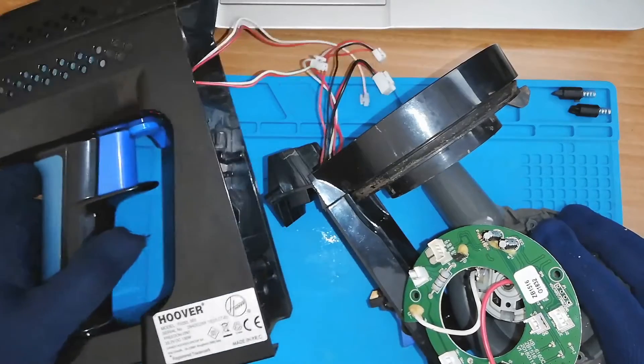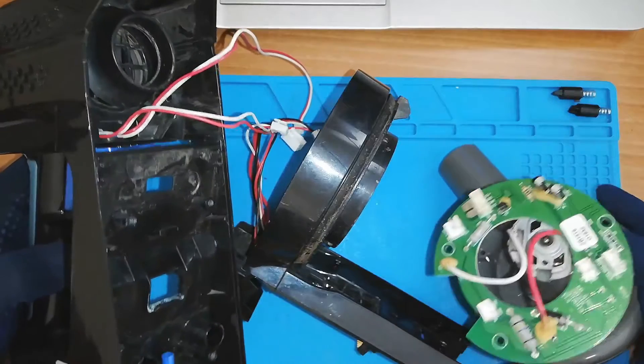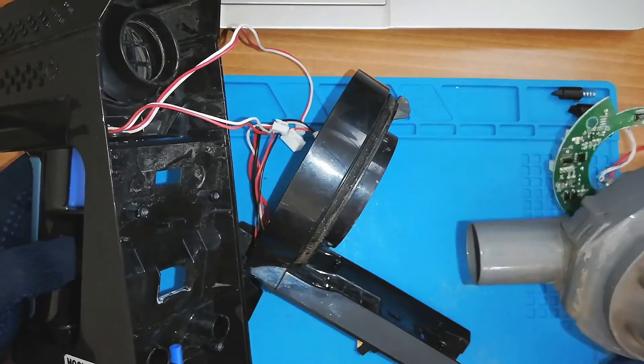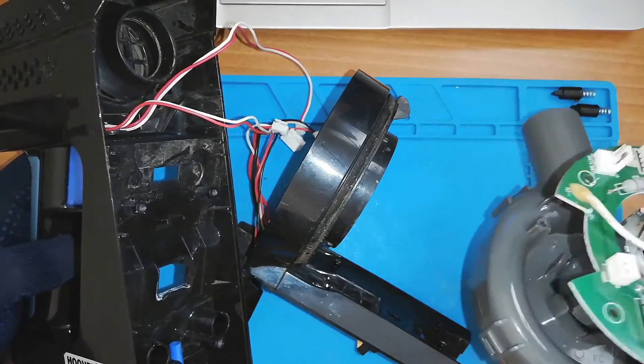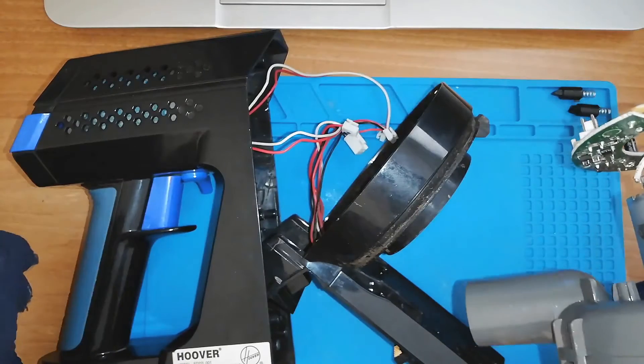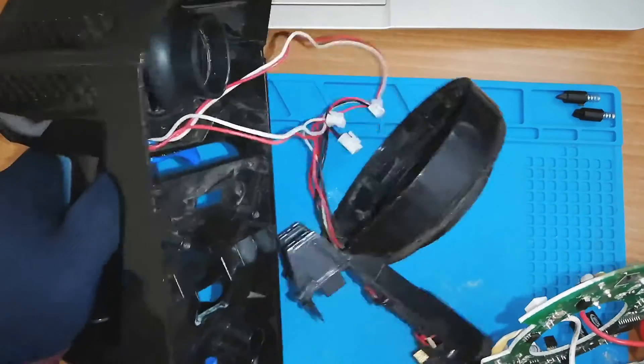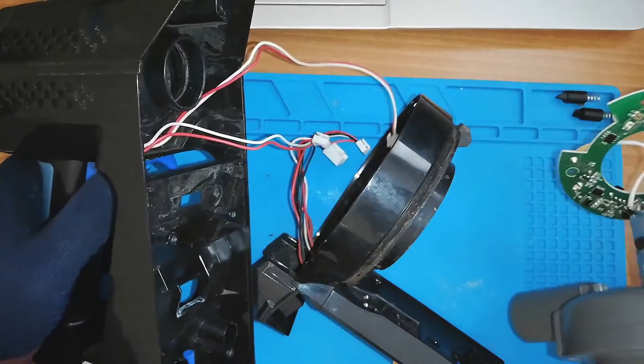I got this Hoover opened up, so I was thinking if we can try and repair it. The problem is that the motor turns on as soon as you put the battery in. My first thought was one of the MOSFETs had gone, which it was. I poked around and tested the switch, but it's all working fine — the continuity is fine.